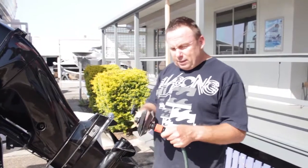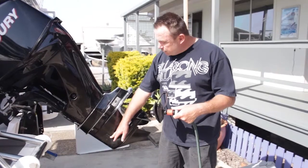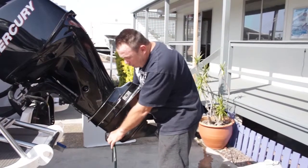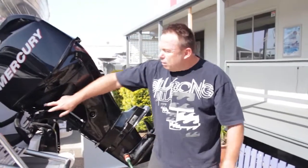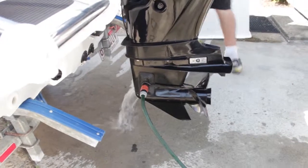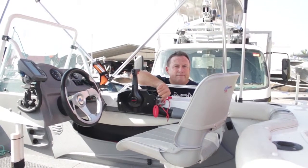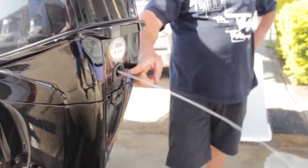To flush the motor out, a nice easy set of muffs costs about $10 and makes life real easy. You'll notice here on this particular gearbox, instead of having the water pickup central, they're actually slightly forward. So a bad mistake people make is putting the muffs on from the front, but the gearbox tapers - while you're standing at the side, they can slide forward and cause engine damage. These actually need to go on from the rear on this particular motor to cover the holes. We trim the motor down, make sure it's nice and level. We'll then go and turn the water on. All you need to do is turn the key and start this engine - it's a fuel injected engine. Once you've got the muffs fitted correctly and water's on, turn the engine on and start it. What we want to look for is water coming out of the telltale to confirm it is pumping water.